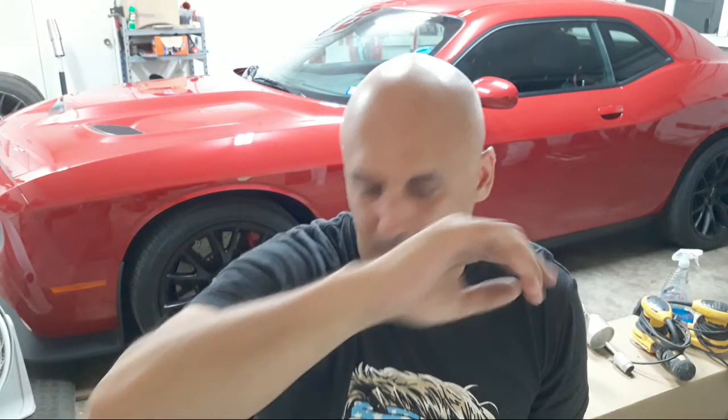Rift is saying, I've had a 180 thermostat on my ProCharge 6.1 for a long time with no problem, and have not tuned for it. Yeah, you don't have to. I'm sure it's better to have it tuned for, but it'll still work. Yes, it is. Extra asks, do you think a 93 octane tune will mess up the longevity of your engine if you're always running 93 octane? No. As a matter of fact, a 93 octane tune is just fine. It's no different, provided that it's done by somebody who knows how to tune your platform. It's running 87 octane in your 93 octane tune that can be detrimental. So if the tune is done right, by somebody with proper knowledge, you'll have a good experience with it.